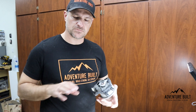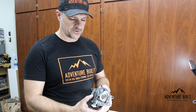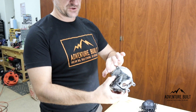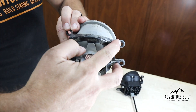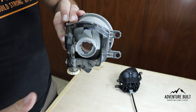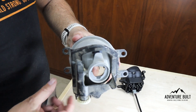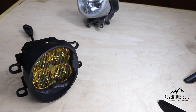When installing, because it's really cramped under there, it's going to be hard to show on the vehicle. So this was the passenger side. These two brackets here slip in here, and then two screws hold the whole housing in place — and that's it. It's actually a really secure hold, and that is the exact same way that the Diode Dynamics brackets line in too.